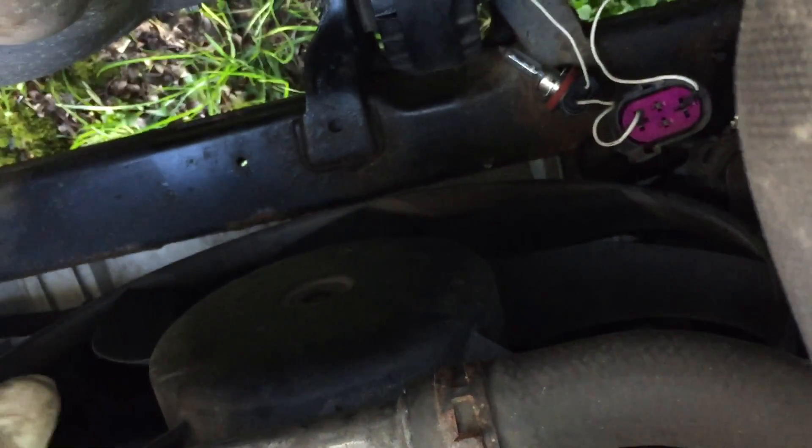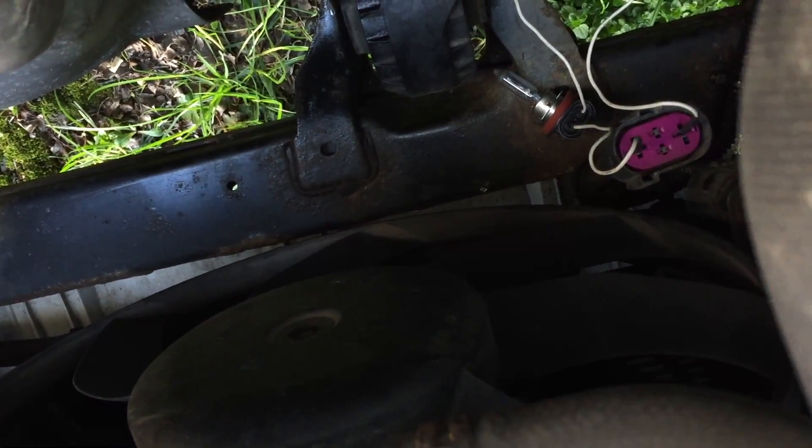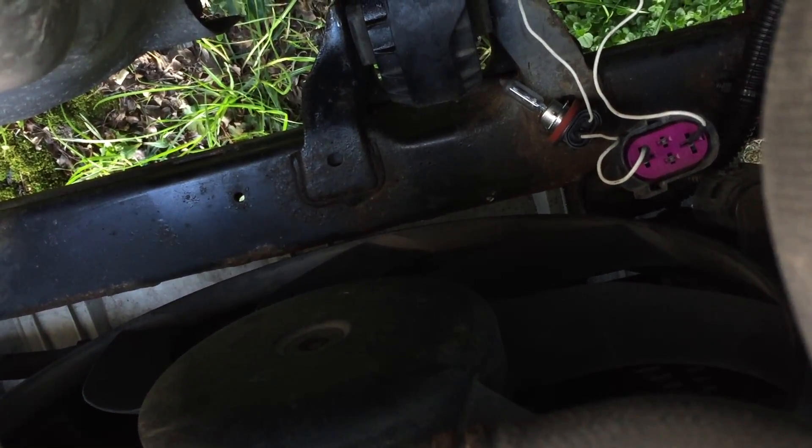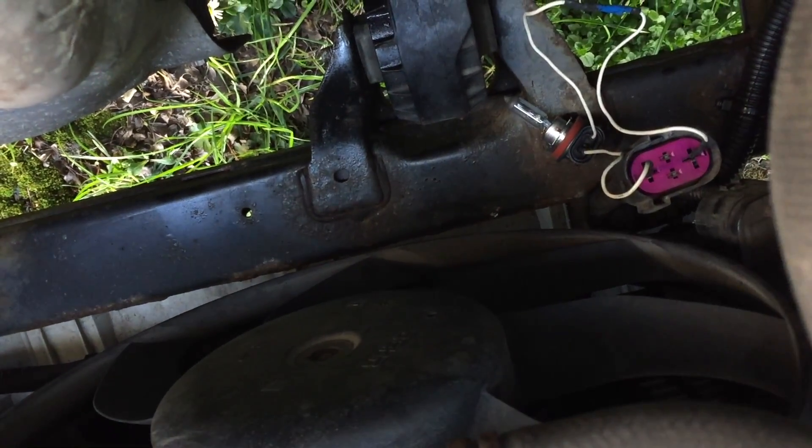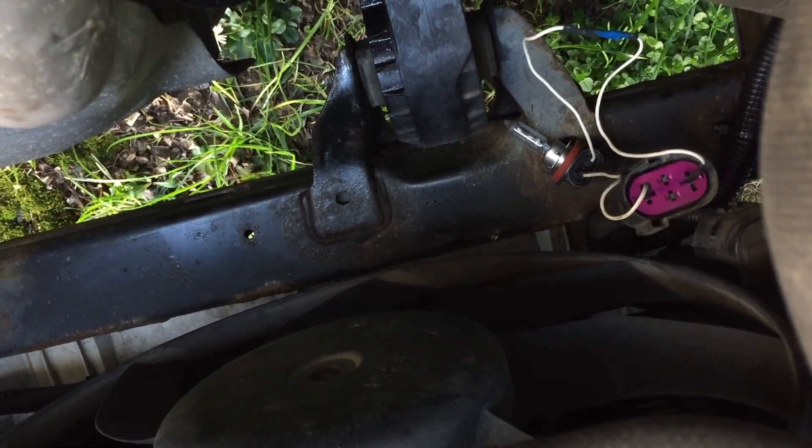You can see either side — the two fat terminals, I call them the two big terminals. They give it a 12-volt feed when you cycle the fan to come on. You can do this test by putting the air conditioning on, but we'll do it via the scan tool. We'll hit 'control fan relay'.